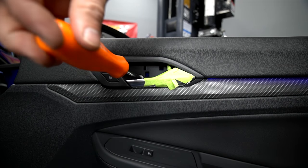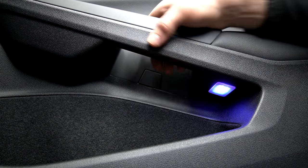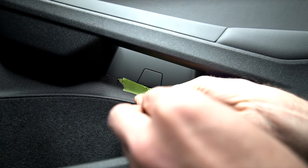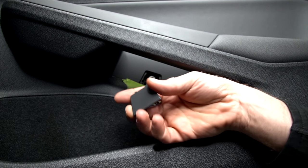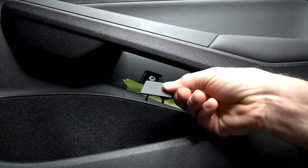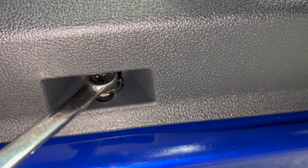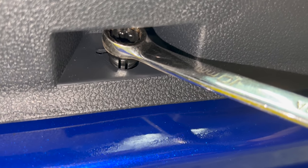Now we've got our T30 exposed — go ahead and take that out. Next we have our cover right in the door pull/close area. I'm gonna go ahead and tape up underneath right where we're gonna be prying. Right in the center there's another recess — that's where we're gonna pry. Once you have it popped up like that, you can get your plastic trim tool and pry it away. We have our clips at the bottom and tabs up top, so it slides up and hooks into the top and then snaps in at the bottom. That reveals our second T30 — go ahead and get that out. For the bottom one, it's simply a plastic quarter turn located underneath the door panel, pretty much center. I like to take a 10mm closed-end box wrench and just rotate it so it lines up with the opening.